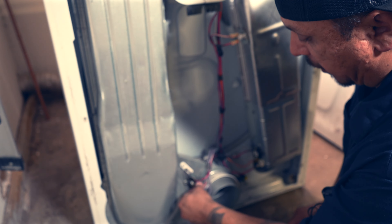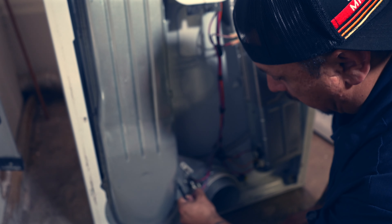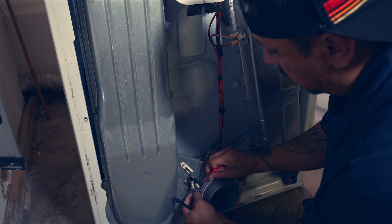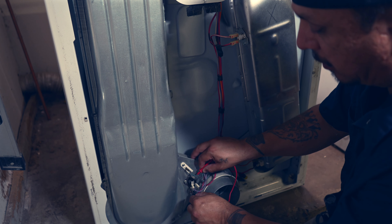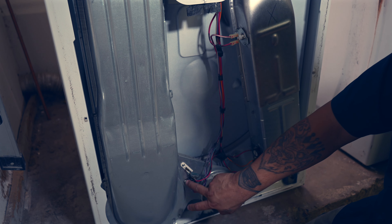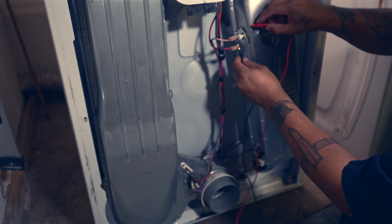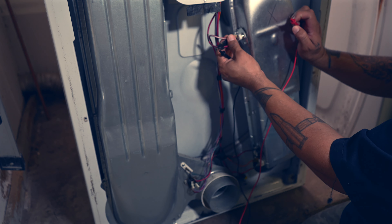On this one I'm going to disconnect these two and check - it's got two other ends on it, just up here and down here. Now I've got those disconnected, let's check for continuity. There it is - we're good there. We'll move on to the next one. We're good here, we're good here, we're going to go up here now. Continuity is the name of the game. You hear that? We have continuity there.